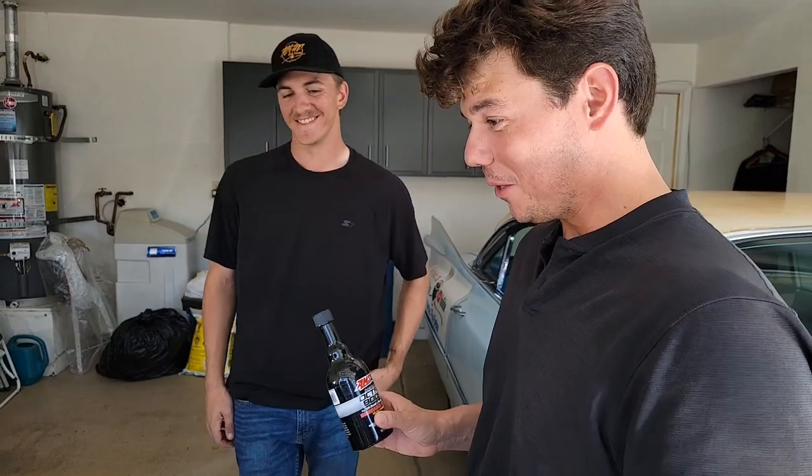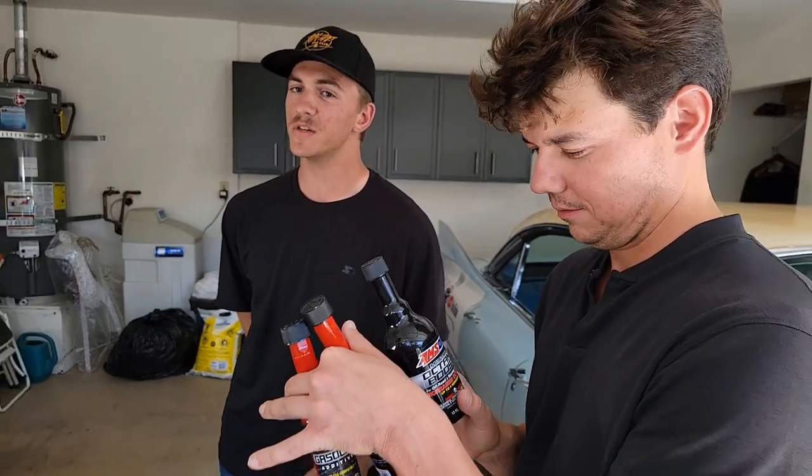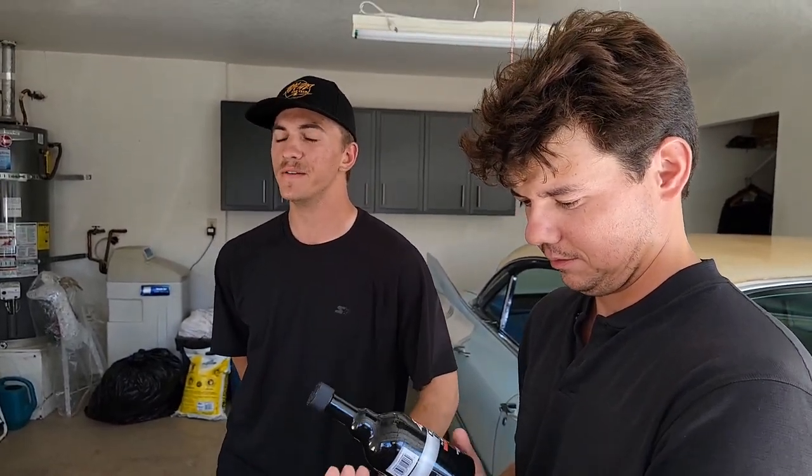So we got the power trio in. Now we got the flush, and all we got to do is circulate this sucker. But Dylan watched what came out of these bottles. Tell him why. So whenever you go through your military job training, as I said before, I'm a helicopter mechanic. So I also deal with fluid changes and such with the helicopters. And whenever you're in tech training, they'll always teach you, look at the fluid coming out before you just dump the whole bottle. Because every once in a while, you'll come across a can of fluid that's not quite what it seems. So you want to catch that before it's all in there, before it's too late.